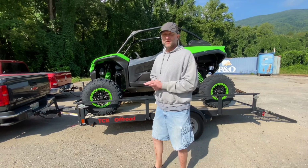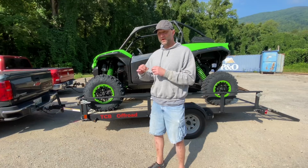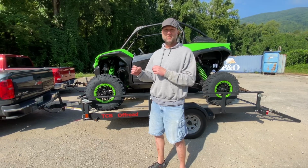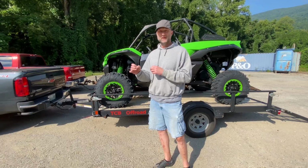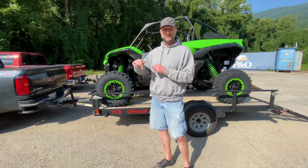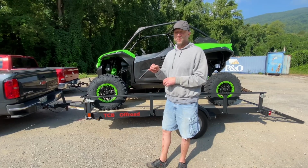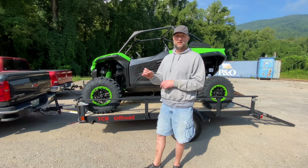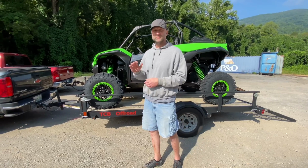But the only concern with that is once we get the yoke off, I'm just afraid that with all the play that was going on with the yoke, it could have possibly damaged my steering rack. That pinion piece that the yoke actually goes into and screws into. So once we get the yoke out, I'm hoping there's no damage to the rack or the threads or anything like that. And all we got to do is replace the yoke and the shaft and it's good to go.